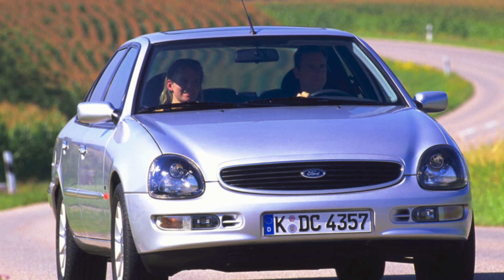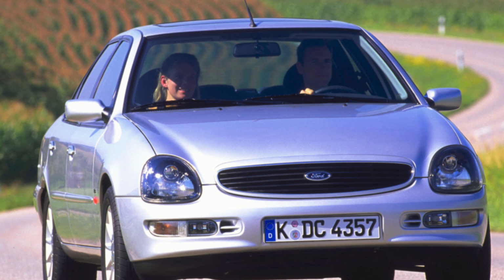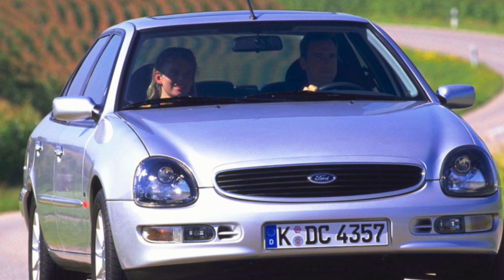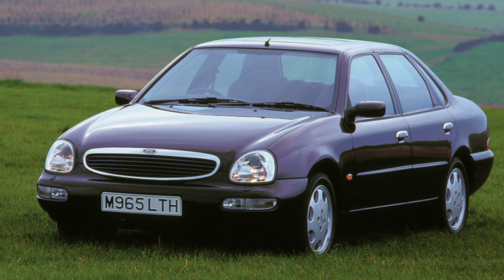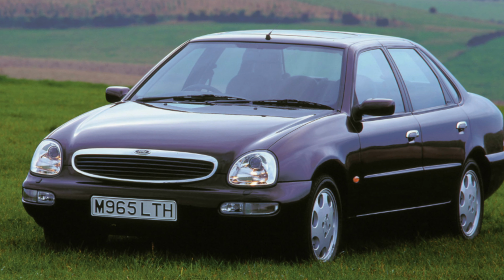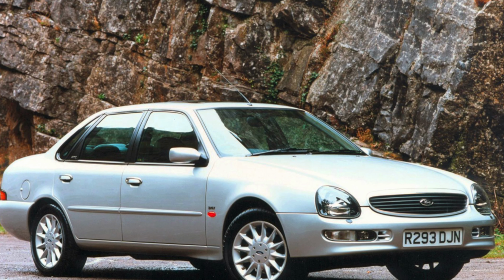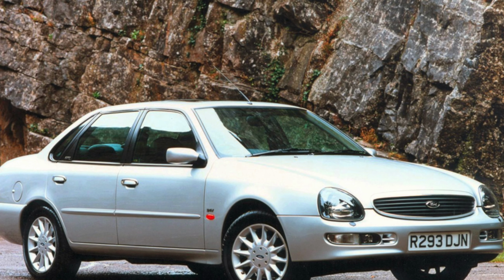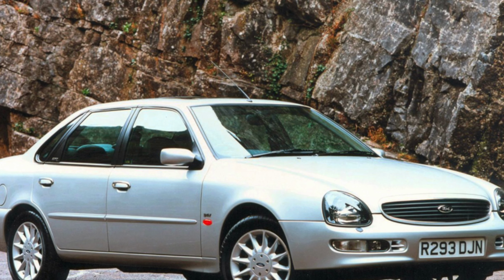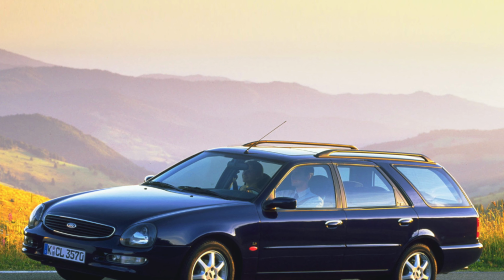The engines were mated to a MT75 5-speed manual transmission, as well as an archaic A4LDE 4-speed automatic, except the 8-valve 2.0. The machine is built on the basis of the old A4LD hydraulic box, which was created back in the early 80s. Index E means the presence of electronic control using solenoids, of which there are a total of 6. The main disadvantages of this box are both mechanics and electronics.